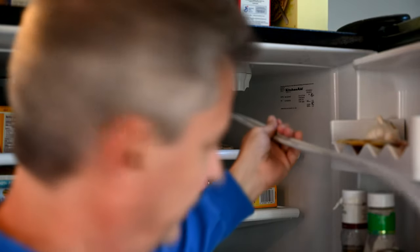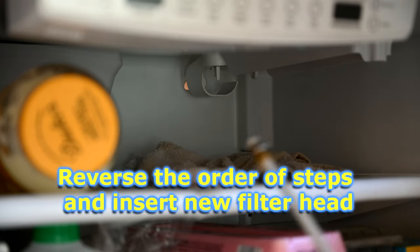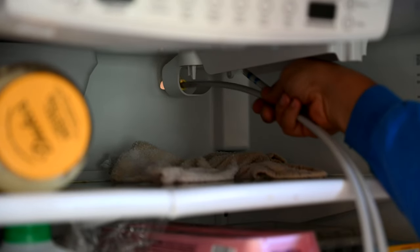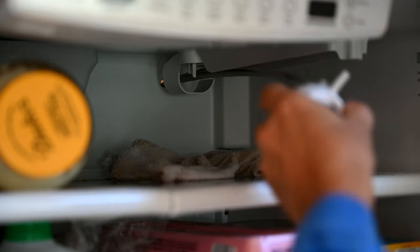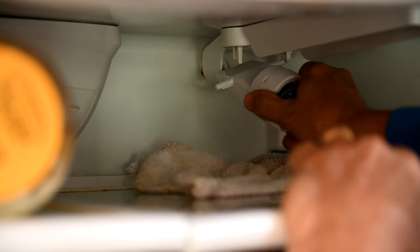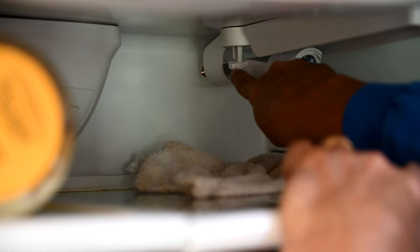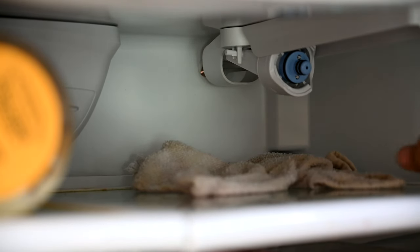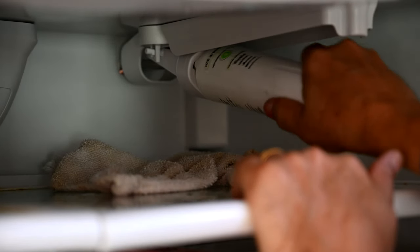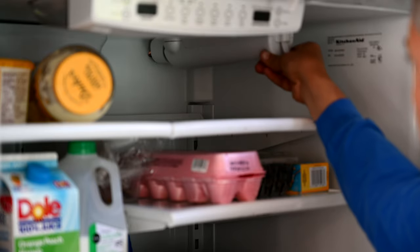Turn your attention back to the top to pull out the insulating styrofoam plug and set it aside. Now pull everything out through the front side of the refrigerator — pull the filter out with the hoses, remove the protective cap, and feed them right through. To put the new filter head in, the right side goes on the loop on the right side, and there's a level horizontal place on the bottom of the left-side peg that snaps up into the snap. Now the filter head is in place — insert the new water filter and snap the door closed.